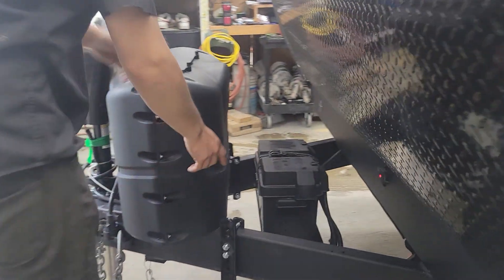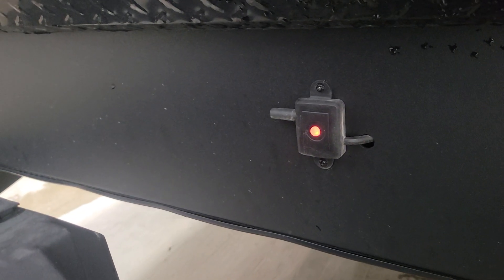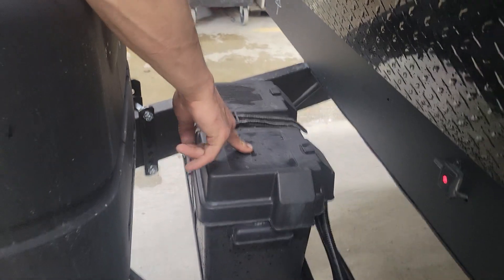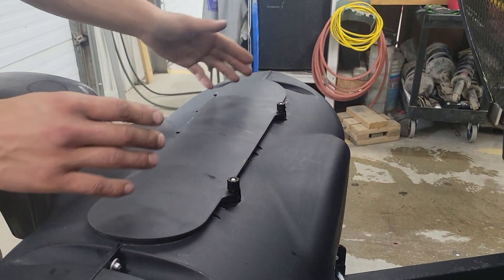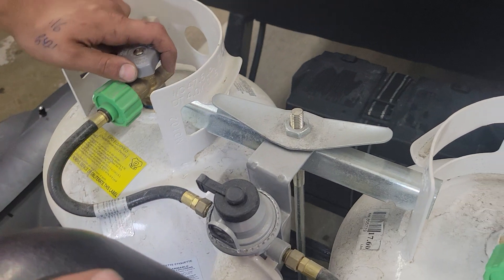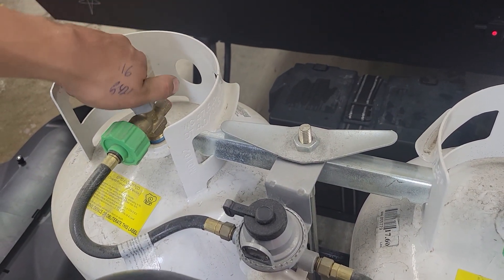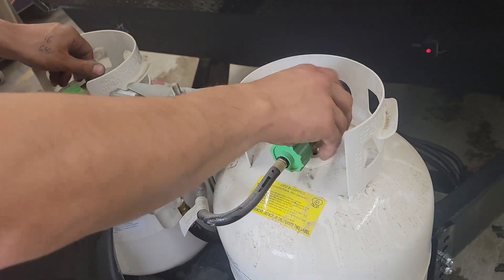Around to the front of the unit — that little black box with the red light is your tire pressure monitor sender. You'll have a little handheld unit that sits inside your truck; it just sends the information to it. Your battery is housed inside this box right here, so as long as you're plugged into the shore cord in the back or your seven-pin to your tow vehicle, that battery will be charging. If you loosen off these two knobs and press back those caps, you get access to your propane tanks. The changeover in the front is currently green, pointing off to this tank, letting us know we're running off this tank and we've got good propane. If it were to go red while you've got that tank open, it's letting you know that tank is now empty — at that point you just flip over to the other tank and run off that one while you get the other one filled.